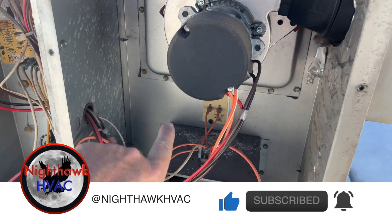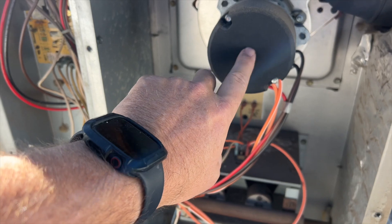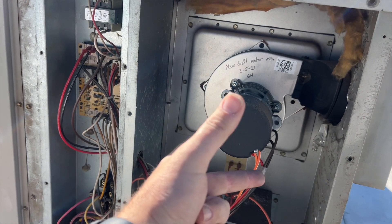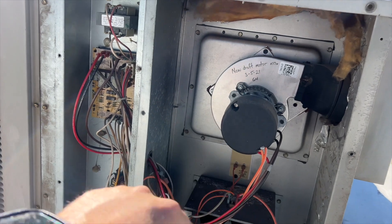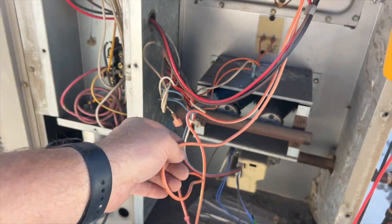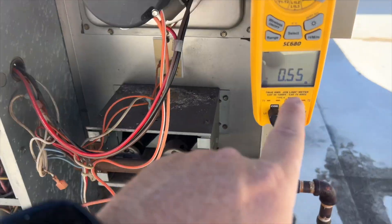You may notice there's no pressure switch here. This is actually a centrifugal switch - when it spins it flings out the pieces which close the switch. We've disconnected our centrifugal switch and it is closed, so that is working.